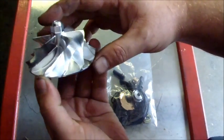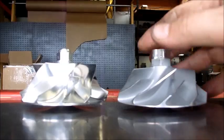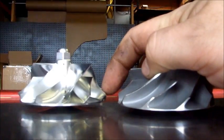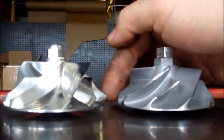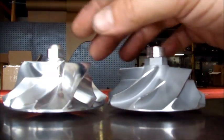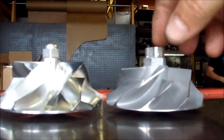This wheel is six fins as opposed to five. I'm going to take the camera off the tripod and lay it flat on the countertop — there are some clear differences. If you look here on this edge, it's pretty much straight up and down, and this tip hardly protrudes. On the six-fin wheel, you can see the tip comes way further out and the top of the blades are much taller. This six-fin wheel is definitely going to spin more air, make more boost, and give quicker spool-up times — but the question is, how much?